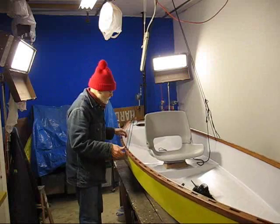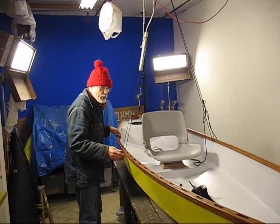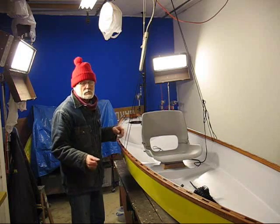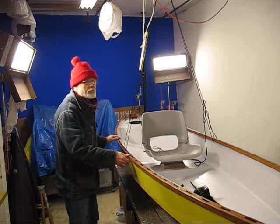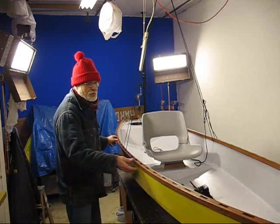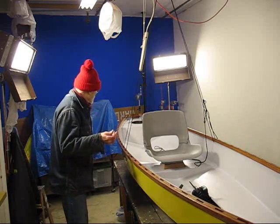I rebalanced the boat on the cords on this center line balance point that I found. I've got about a 12-foot 6-inch waterline, 6 feet 4 inches forward, 6 feet 2 inches aft. I'll put some tape down to mark the position of the seat and put in a couple temporary screws to hold it in place, but I'm not going to do any more adjustments until I get the motor and actually put it in the water. I think I see one mod — I'm going to see if I can get Joe to lengthen the battery-to-motor cable a little bit. Until we get her in the water, this will do it. See you guys later.